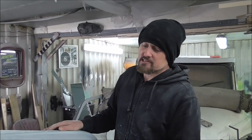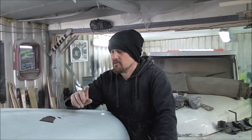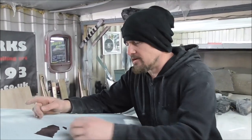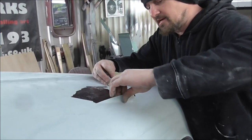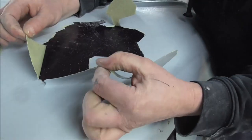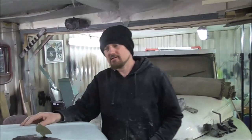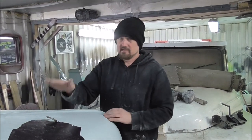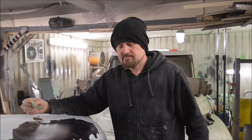In doing the bonnet and on that door, I've noticed that on some of these grey panels, as I've ground the paint off, it has come off really quickly and really thickly right through to the gel coat. There was a small crack in this bonnet, and I thought it was a crack, but it's actually the paint just coming away. And then underneath is this funky purple metal flake paint that feels like it's been waxed before someone painted over it. So I'll be stripping that bonnet. But in the meantime, down in the middle, I'll grind all this paint off and get it bonded together.